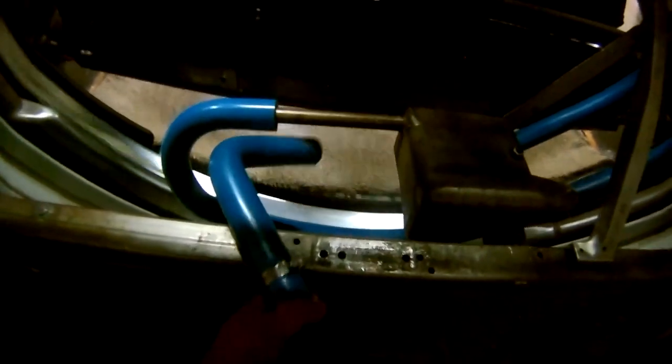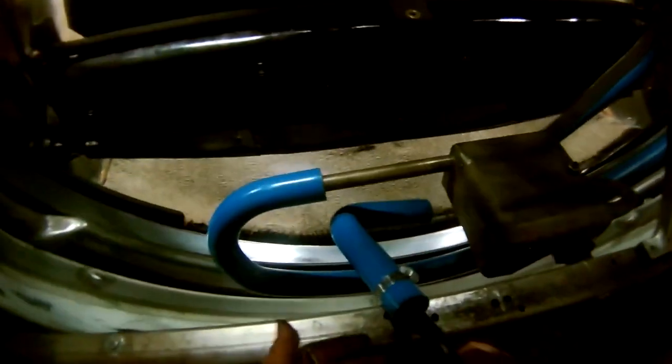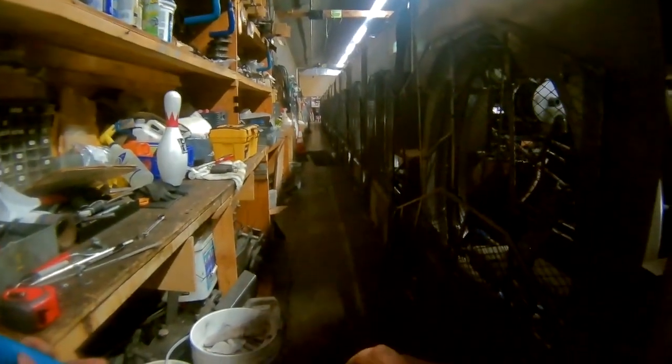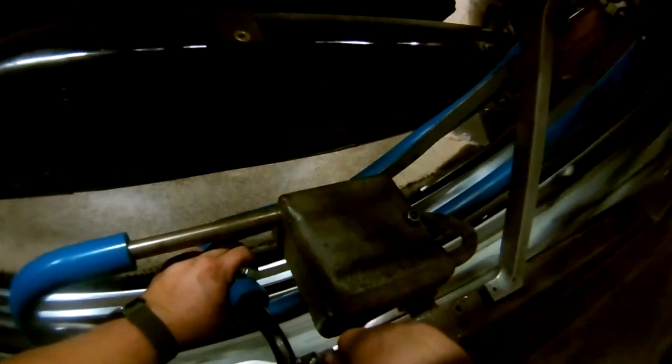And to start with that, we're going to loosen the nut. And we're going to raise it up out of the way so that it's not blocking balls while we're adjusting it. There we go. Now, I know I have personally adjusted this several times. I know somebody else came in here adjusting it, because when they adjusted it and I was watching them, they added that nylock nut. They had me add that nylock nut so that it had more of a base to land on. Gives it a foot. So we're going to go back into the holes as designed when it was installed.